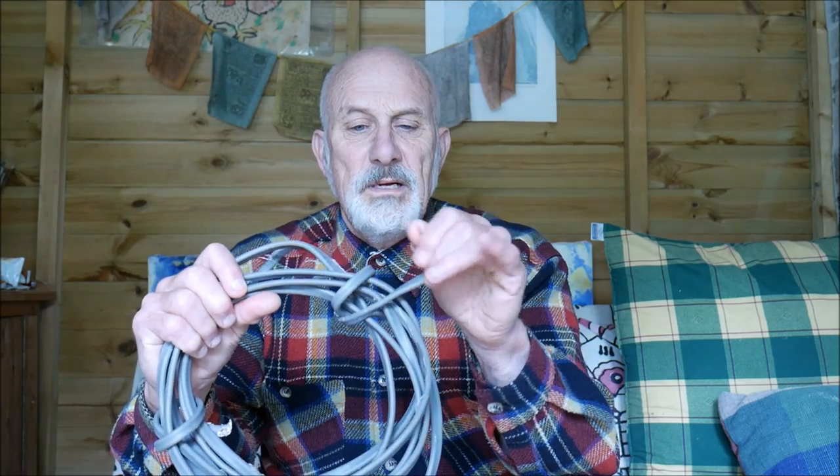It's quite easy to cure actually. Get new batteries, open it up, get sandpaper or preferably a little mini file, rub away to get rid of that green corrosion. Sometimes it becomes quite pitted, and what helps in that situation is get some cable — this is about a 16-amp cable. Strip a sheath of wire so you've got a piece of copper wire, get a pencil, coil it round the pencil, snip it off, and what you've got is a little mini copper washer. Slip it in against the terminal, put your batteries back in, and you've got a snug fit — copper is a brilliant conductor, and that often helps if it's quite corroded. So basically it's a corrosion problem nine times out of ten.